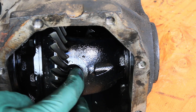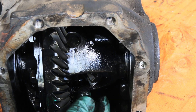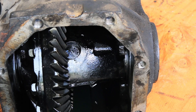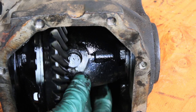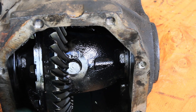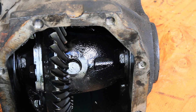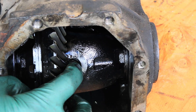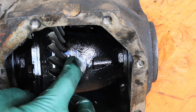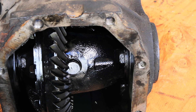This is the first time I've really seen anything this bad. I don't know what caused it — probably a lack of lubrication or really old lubrication, with a lot of mileage on the rear end. I wanted to show you this so if you ever take the rear cover off or you're doing any other service on your rear end, be sure and check these pins for excessive wear. The moral of the story is: if you've got a clunking sound back there, don't assume it's only your axles.